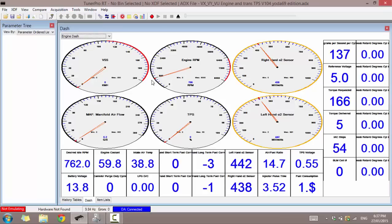It's very common. If you didn't hear just then, my cluster LCD, you just heard that little chime. It's the engine check chime. That's normal. You don't have to worry. You don't have to freak out. That happens every time. This occurs due to how the software communicates with the vehicle. It actually stops the communication in the vehicle so that it can read the live engine data as quick as it can, which is what we're seeing here. That's how we see our values very smoothly.